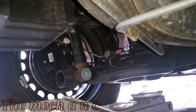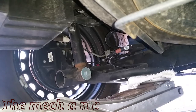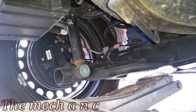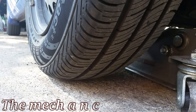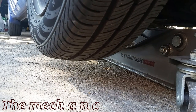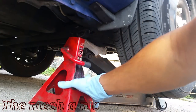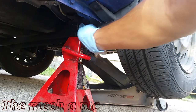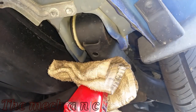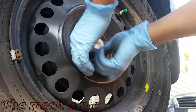Coming from the rear of the car, you'll see this bump right here underneath the rear spring, and that's a pretty safe spot to jack up the car from. After you lift your car up, you always want to grab jack stands — do not rely on the floor jack because they're not safe at all. There's a really good spot to put your jack stand, which is right here on the rear trailing arm. You can actually see a flat spot on the trailing arm, and that's a perfect spot. Now with the car secure on jack stands, it's safe to take the wheel off.